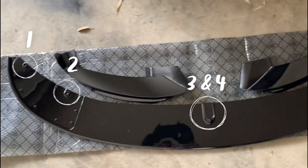After you've put on the tape, peel it back a little and fold it up, making a crease, so that once you've positioned it correctly on the bumper it'll be easy to stick down and remove the red part. Do that on both sides. The lip will already have six pre-drilled holes that'll line up with the holes that are already under the front bumper.